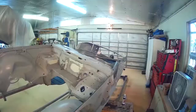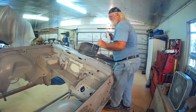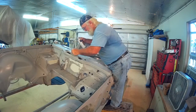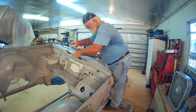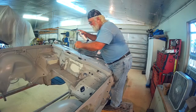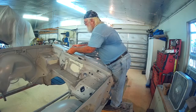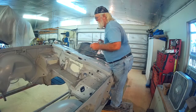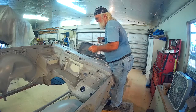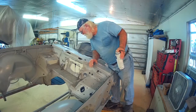Here's the spray pattern — it comes out in four areas and you drag it, and it's pretty thorough coverage. So I sprayed it from the inside, gave it another coat reaching from a different angle. This is where the cleanup part comes in. I haven't seam sealed any of the edges yet; I wanted to get this encapsulator in before I had put any primer or anything. Here it found a spot to ooze out onto the front.